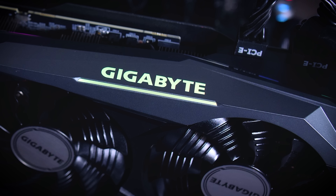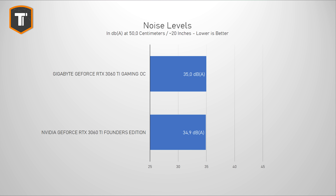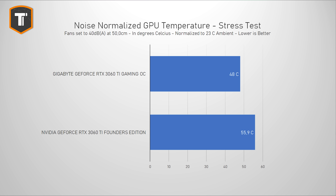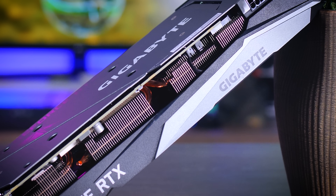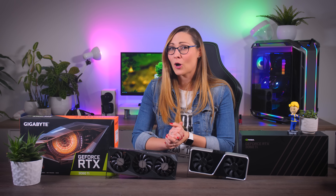Both cards remain super quiet — they turn off their fans completely at idle, and under load they do around 35 decibels at 50 centimeters distance, which is barely any noise at all. The Gigabyte card does stay a lot cooler though; the Founders Edition temperatures are completely fine, especially for a smaller case that won't fit the big Gigabyte card. But obviously a bigger heatsink with three fans will do better if you have the space. Unfortunately, I can't show the quiet BIOS results as this early Gigabyte sample came with two identical BIOS versions installed, but retail models should have this right — I'd expect temps around 60°C in silent mode.